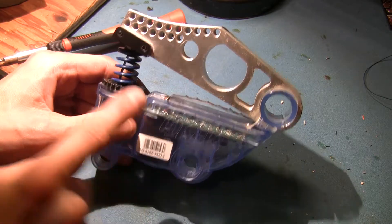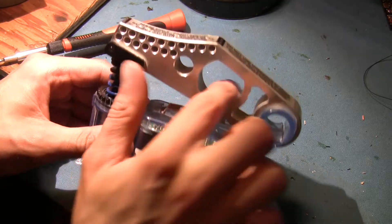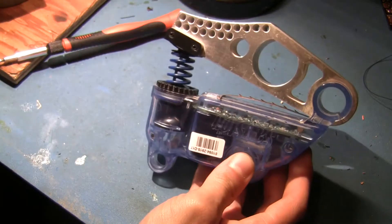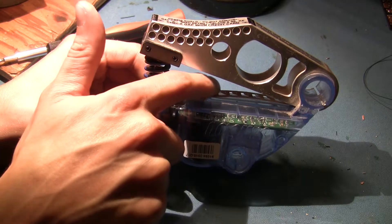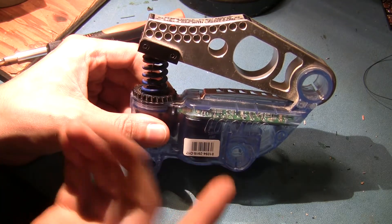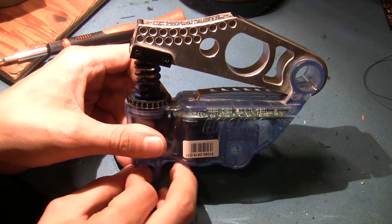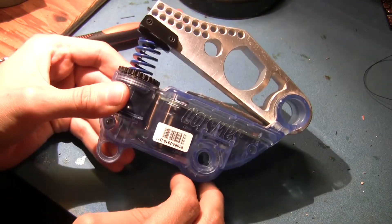There are videos on YouTube of people intentionally testing this by touching the blade with their bare hands and they're not severely injured at the end of the day. Clearly this has been used, as you can see from the bite marks on it. These things are prone to false positives — they use an electrical method for detecting foreign masses on the blade, whether capacitive or resistive. If it detects something presenting an electrical load on the blade, it activates and stops it. What happened was my friend lowered a metal measuring tape onto the blade by accident, the system detected that and triggered. Unfortunately these are single use only, so once it goes off you have to get a new cartridge.